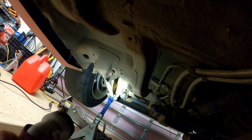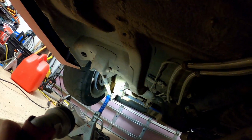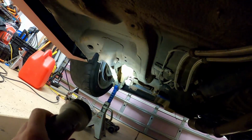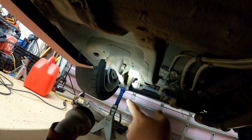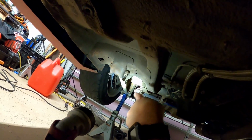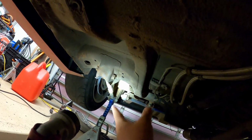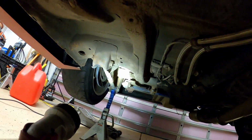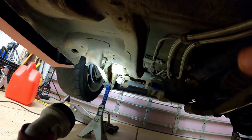To do that, you have to have, well, they're really dirty, but adjustable fourlinks. I use Megan ones right now. They work all right. But you'll also see I have non-typical fourlink mounts. These are from Excessive Manufacturing, so I've got a couple different height options for them, for the upper and the lower. It helps with anti-squat. So I have mine set up with the correct pinion angle.